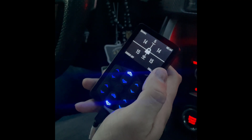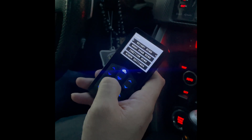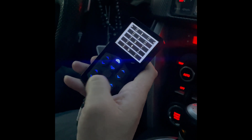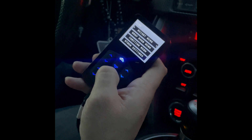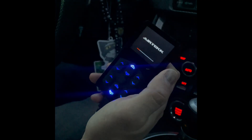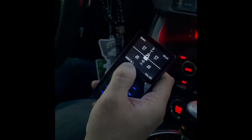To turn on rise on start: double-click and hold for a few seconds to get into the BIOS. Select the drop-down menu called the ignition menu — ignition is rise on start. Select it, set your preset to number three, click up, and confirm level three. Now whenever you start the car it will automatically air up. You'll then see 'startup on three,' meaning the car will rise to preset three on every startup.